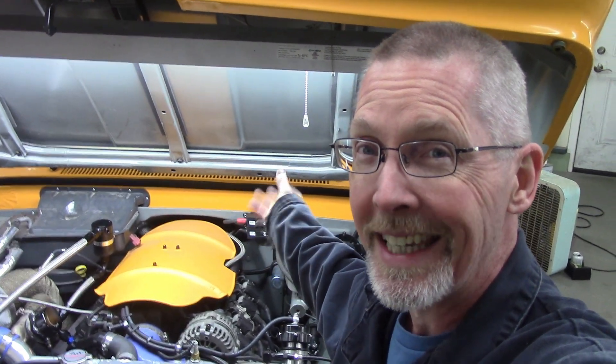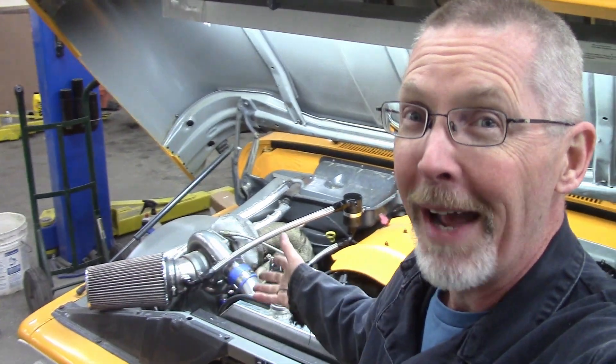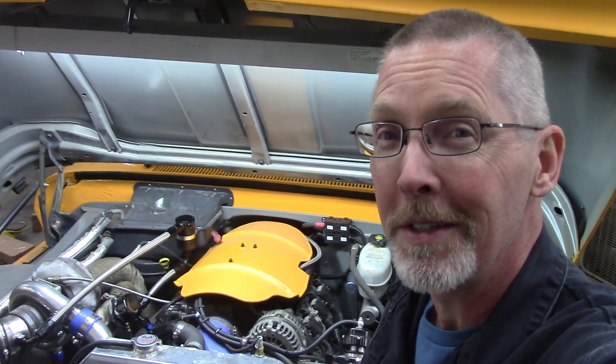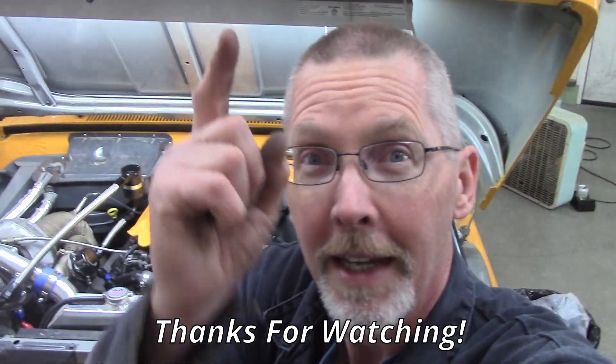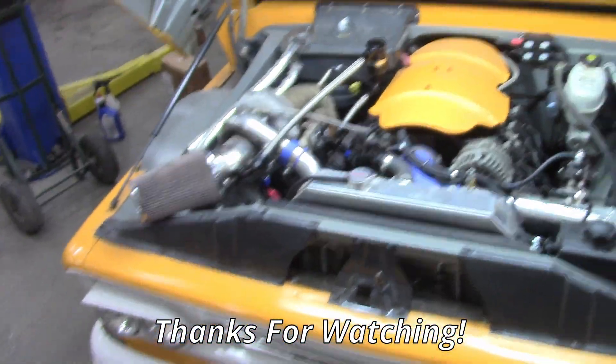There are lots of opinions on the internet about how this should and should not be done. This is set up strictly for a boost system. Some guys will put the catch can between the valve cover and the intake manifold to catch debris so it doesn't get sucked into your motor. What I don't want is massive amounts of oil being pushed into the intake system, into the turbo, and all of that — and under a turbo engine, that's more of an issue. Nevertheless, I want to save the environment at least a little bit — we've got to breathe that air. Vote Quimby. As always, thanks for watching, take care, and we will see you again.